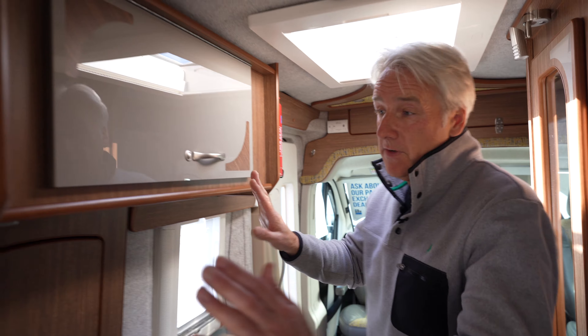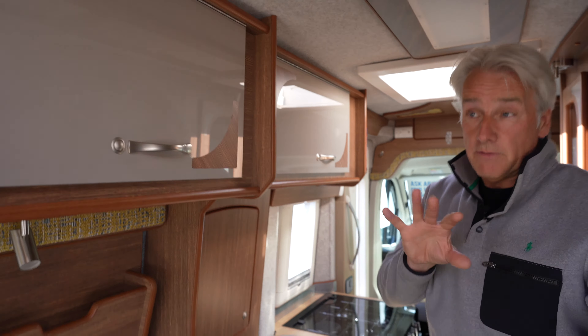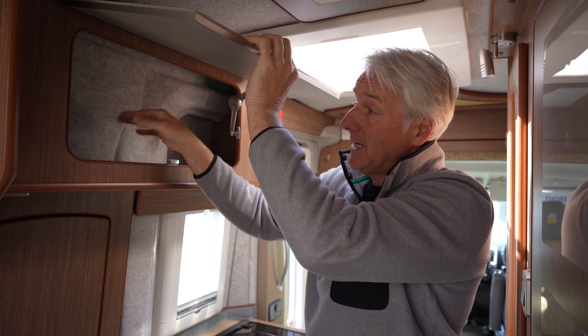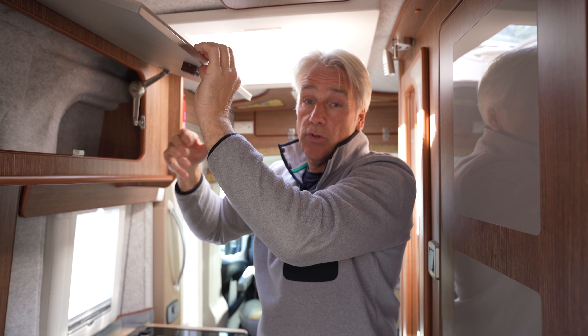Compared to some other models we do, this is the other way around, because we can use the benefits of the indentation into the panel here, which gives you more room in this area. As regards storage, it's completely different — because when you go in a coachbuild you'd expect more purposeful storage. In a panel van we try to make use of the cavities. When designing this, notice this is a bit further back — because when you're standing further back here you've got more face space, and when your head's down over the cooking facilities it goes away from you.